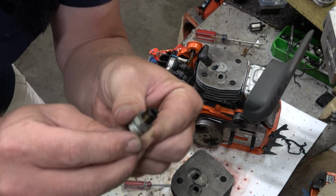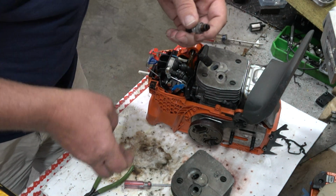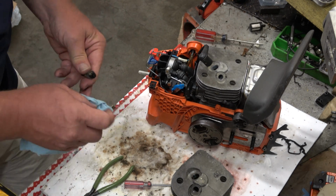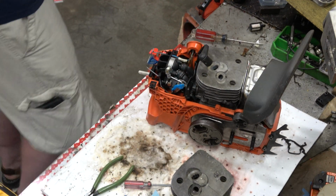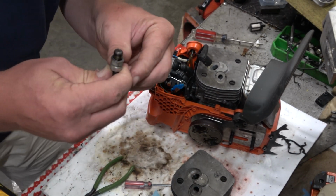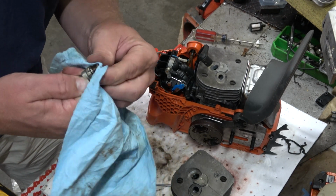Alright. Now that valve has some crapola and some rustola. It doesn't appear to necessarily be on the seat itself. It appears to just be carbon. I am going to lightly, with the valve closed, wire wheel that off. I feel better about that. The sealing washer's not all torn up. I think we can use it again.